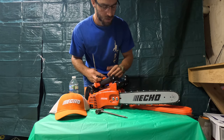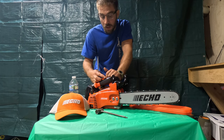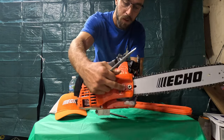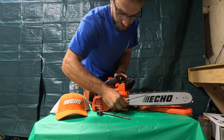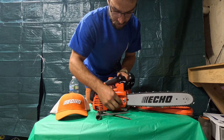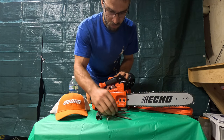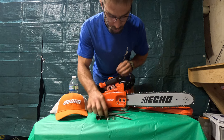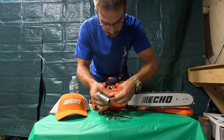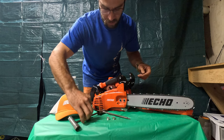So we're going to start with the basics. You've got your saw, you've started running it, maybe you hit some dirt or a nail, or you just haven't cleaned it in a while and you've got a bunch of sawdust caked up in there. Take these two nuts and loosen them up. It's also good to make sure the brake is off for later when you're putting the chain back on. Pro tip: take your flat head — this is your adjuster, the tensioner screw — and back it off about seven or eight twists. That'll make it easier when you go to put the cover back on later.